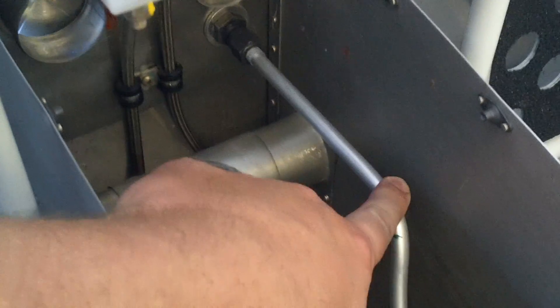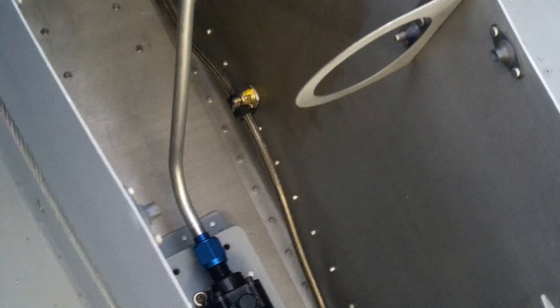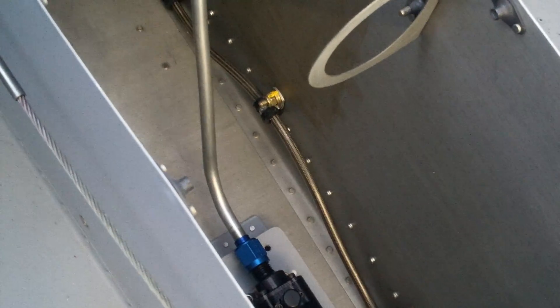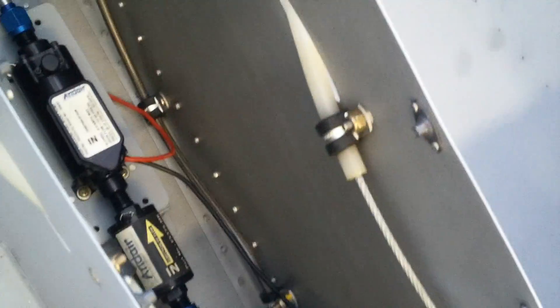I'm probably going to walk around here to the other side. I'm probably going to get rid of this aluminum hard line — that's just a really long run that makes me a little bit nervous. I'm probably going to put that on with a TSO'd Teflon line and bring it along from the firewall along the side of the tunnel and then bring it down. This is a pretty lengthy run of a couple of feet that is not supported all that well, and I'd feel much better if it was just a hose, so I'll probably replace that one little section with hose. But that's my installation.